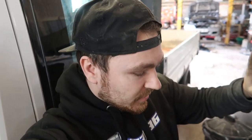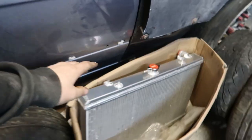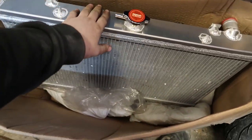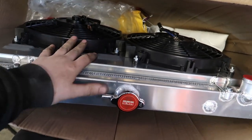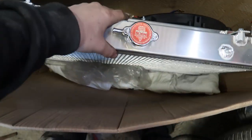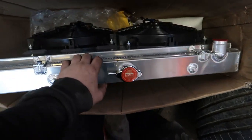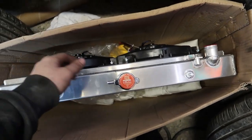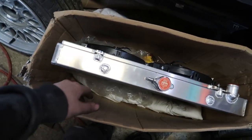But today we're going to be tackling the cooling system and we are going to be fitting an SR rad from S13 or S14 — I think it's from S14. I've put the crossbar on just so that we know where to mark it. Here's the radiator — this is actually Ross's one but we're going to be getting the same one anyway. Comes with a shroud and two e-fans, a relay kit for the fans, and a thermometer switch as well if you want to run that. Ours we're going to be running off the ECU and then using the factory temperature gauge.